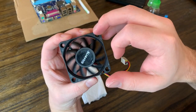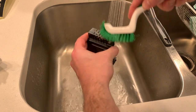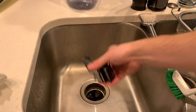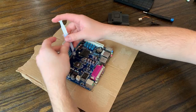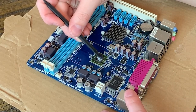The final result is pretty solid — it's looking good. Getting into the heat sink with a paper towel or q-tip is tough, so instead I'm using a brush and some dish soap to scrub everything out, and after it dries off it's looking pretty good. Once the heat sink was completely dry, it was time to put some thermal paste on the die and then use a spudger to spread it out nice and evenly.